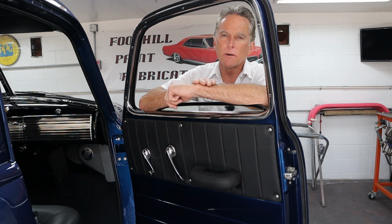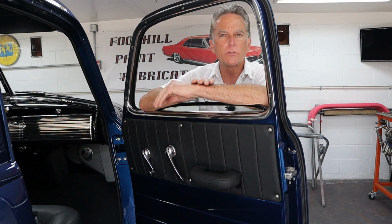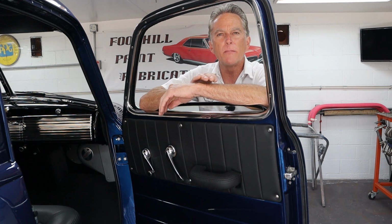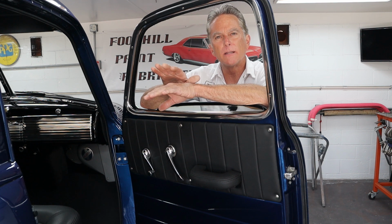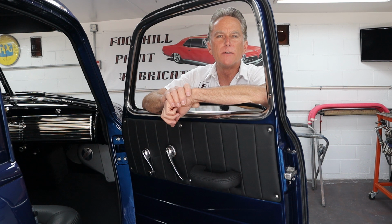I make mistakes, you're going to make mistakes, but they are correctable without reshooting the whole panel or the whole truck or car or whatever you're doing. It's better to try it first before you go to really extravagant lengths to try to fix something that maybe could be fixed fairly easily. So remember that. Give it a try if you need to. That's one of the best things about base coat, clear coat. You can do this stuff. You can put some more base coat down and then blend in the clear, sand it all, polish it, and it doesn't show.